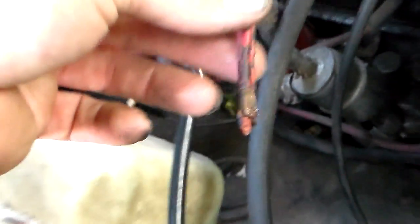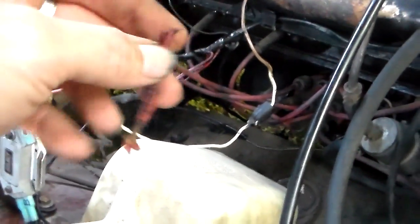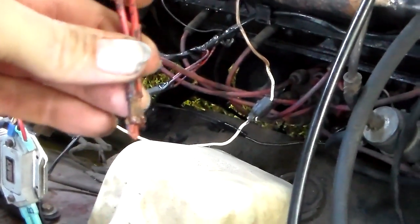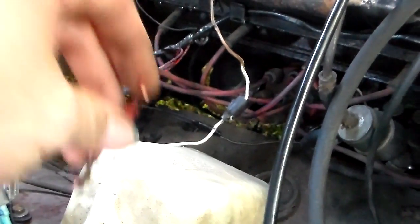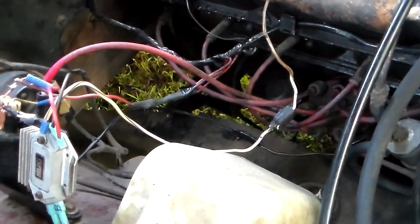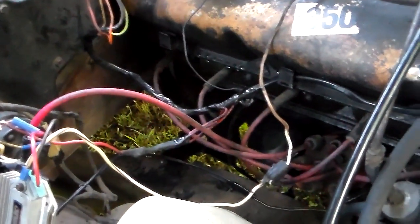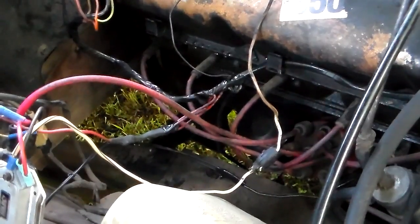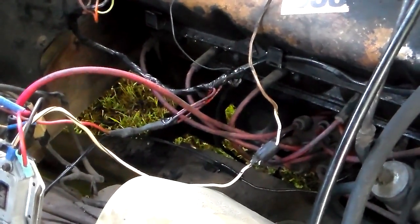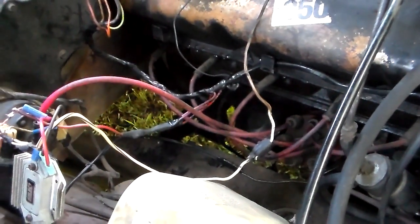The red one is the one we're dealing with over here. What happens is this red wire originally goes into a welded splice right here, buried in that harness. The reason being is this wire does about three or four different functions — it supplies ignition-on power to a few things. It provides power to the lean burn computer, power to one of the field terminals on the alternator, and power to the choke through the oil pressure switch. I'm also using it to provide power to my ignition system.